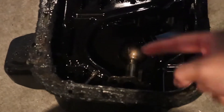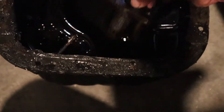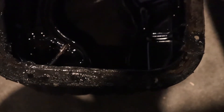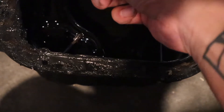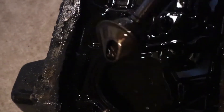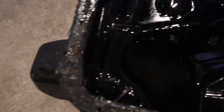If you guys are taking your oil pan off, don't forget to remove the oil pickup — that's what sucks up your motor oil. While it's already out, inspect it and make sure nothing is clogged. Check for any large metal shavings in there, and make sure it's not clogged before you put it back so you don't have to do it again.